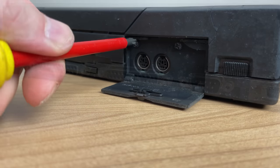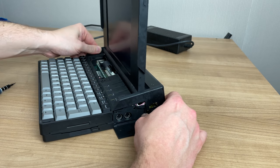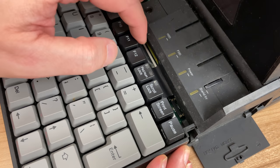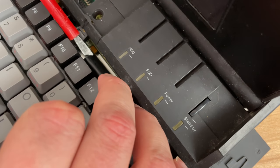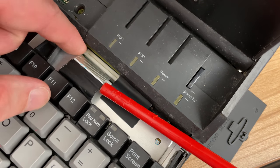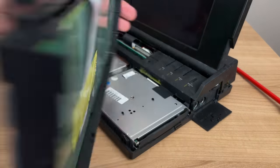There are a couple of screws on the back, on the side, and on the bottom. Once all of these screws are removed we can gently open this up, which is always a little tricky with these laptops because there is a specific sequence you need to go through. In this case we need to remove the keyboard first, which slides out. You need to be very careful because the ribbon cable of the keyboard is very short and you don't want to break it off - gently getting that flex cable off is very tricky because it's very space limited.